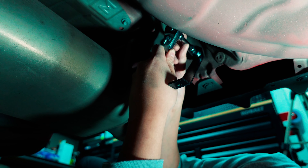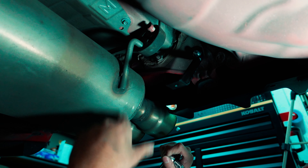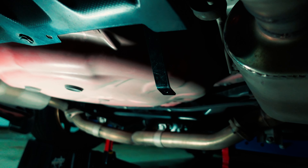Make sure it's as level as possible before tightening it down — I'm using an 11 millimeter socket. Tighten it a decent amount since there's going to be some weight on there from the diffuser. Once that's done, let's install the shorter bracket. Here's what it looks like so far: the first bracket is facing towards the front of the car, with the nut visible on the other side. Super easy.